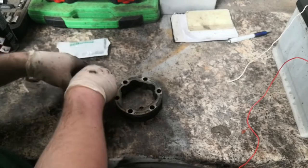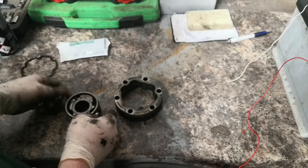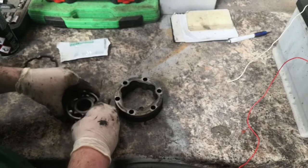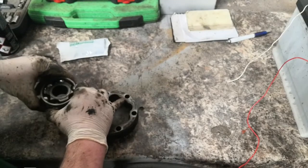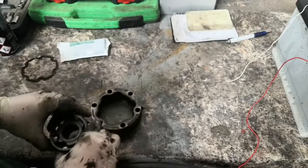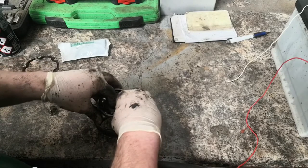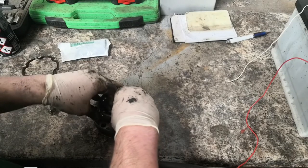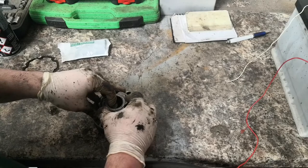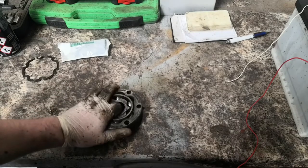How I want to do it is get all the ball bearings and put the cage around that piece and put all the ball bearings in — this is the easiest way I've found so far. Now, you can see how it's got big bit, small bit, big bit, small bit. It wants to be the opposite on this because when it's at full extent it'll line up. So I'll put the big bit in line with the small bit like that, then without letting the centre bit drop, put two fingers in the middle and pull it all the way up until it all drops into place. Right, so that's dropped into place now. I just need to pull it up a touch more and then it should all drop down — just like that. So that CV joint's back together now.